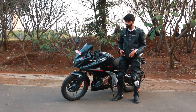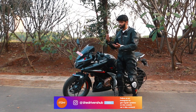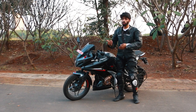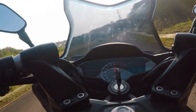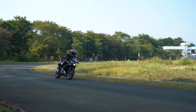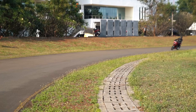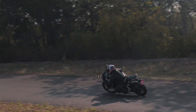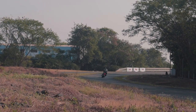The engine makes 24.5bhp and 21.5Nm of torque — that's as much power as the NS200, and more torque. These figures are also accessible earlier in the power band compared to the NS200, so even with only a 5-speed gearbox, the power is delivered earlier and is more usable. The F250 isn't as nimble as the NS200 or the N250 and does carry some extra weight through corners, but it is definitely more confidence-inspiring than the N250, and on the straight here at Bajaj's test track, it feels a lot more stable and planted than its naked sibling.